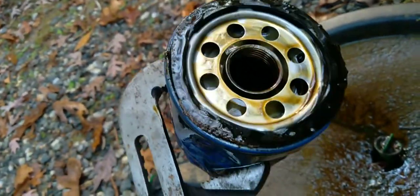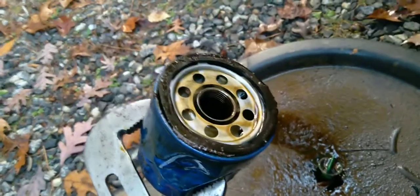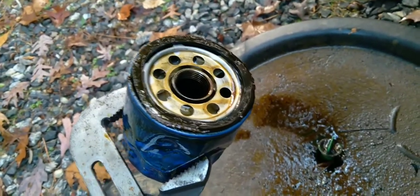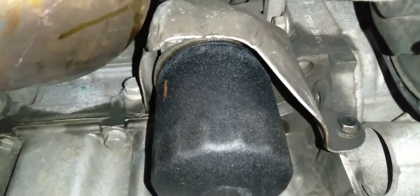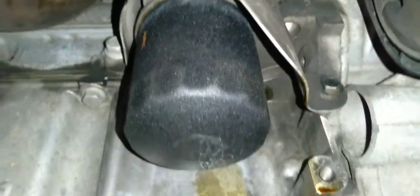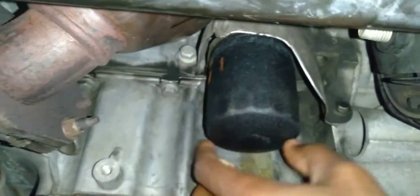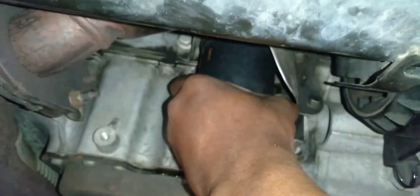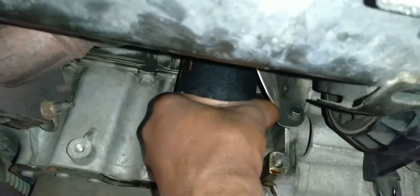Get a good grip — that's why this thing turned out so crushed and smashed, but it works. Try some channel locks. If all else fails, don't spaz out — get some channel locks. You can just crimp it a little bit, give you a grip, and go ahead and twist that thing off. That's the new one — you see how little space I had to work with. Just make sure you hand tighten the new one. Do not use a tool or channel locks or anything like that to apply the new filter because you may not get it off. Thanks for watching, have a blessed day.